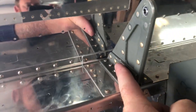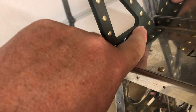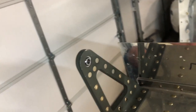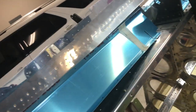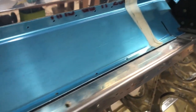When I test fit my ailerons, we were binding up here at the shop head of the rivet, and also getting a little binding here. So I'm probably going to drill these out and flush rivet them from this side. You can put some additional washers there, or bend some stuff and trim the ailerons, but I think I'm just going to put three flush rivets there — the only reason you need those three is because when this goes in, only those three would ever have a chance of contacting the aileron.